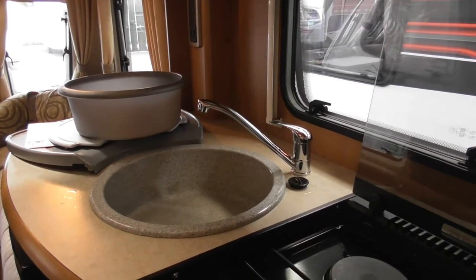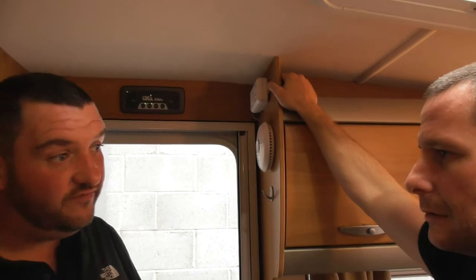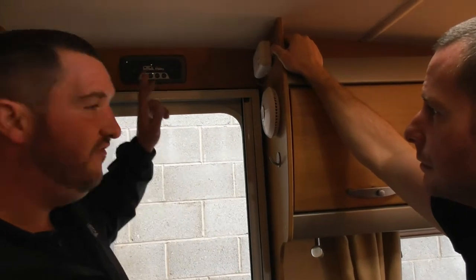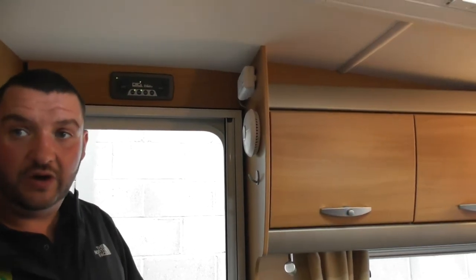We'll get the heater. And does that pump then go, do you have to turn it off and on? No, you can leave it on now because you hear it's not running. The only time it will run now is, A, if you're asking for water, or B, if you've run out of water externally, it's looking for water to repressurise it up. So all you need to do is switch it off, refill your aquaroll, switch it back on, and pull the air back out of the system. So simply pull air through the hot and the cold side of the tap.